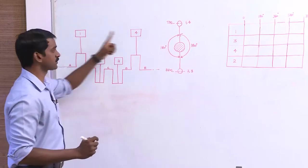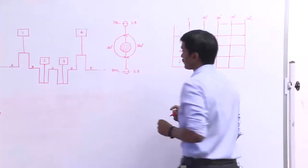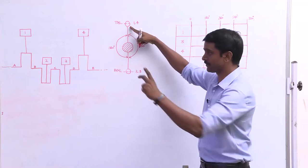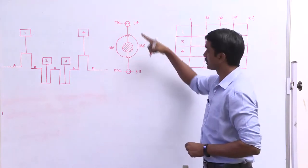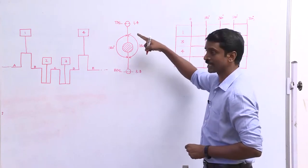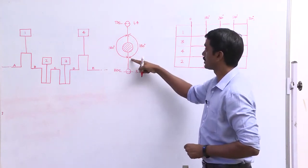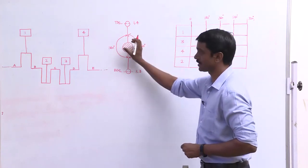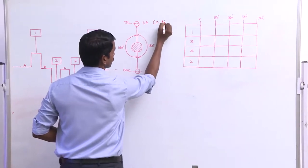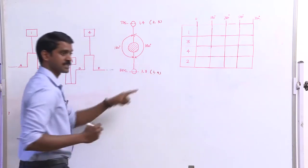Pair 1 and 4 is shifted by 180 degrees relative to pair 2 and 3. The hatched portion represents the crankshaft main bearing journals, and from the front view, these are the crankpin journals of 1 and 4, and these are the crankpin journals of 2 and 3. At any given time, when 1 and 4 are at TDC, 2 and 3 are at BDC. After 180 degrees of rotation, 2 and 3 will be at top dead center and cylinders 1 and 4 will be at bottom dead center.